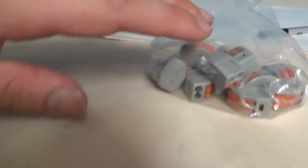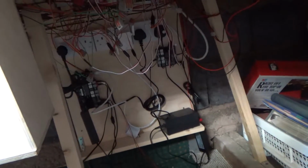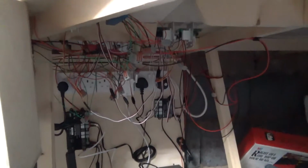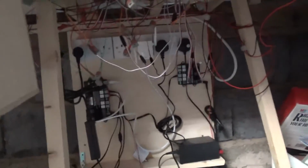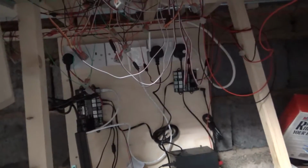especially when you're having a short under there and you're pulling everything out to figure out what it was, and it was so simple. It was just pull back on the things and release the wires, and then put them back one at a time and just snap them back on, so much easier. Those old terminal blocks, the blooming screws kept falling out while you're upside down and you're just trying to hold the wire in, and then, oh, yeah, right mess.